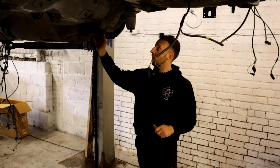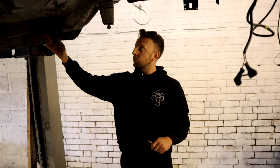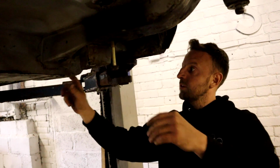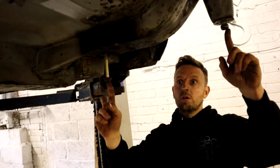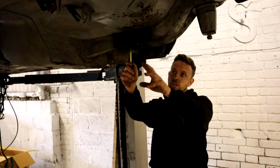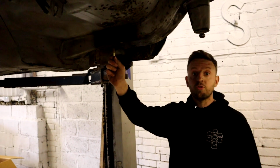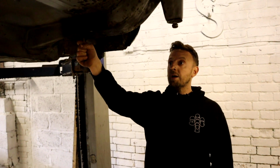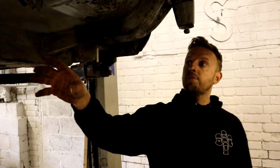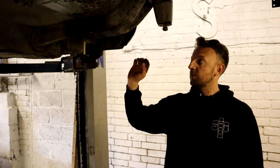As soon as you start cutting apart, you lose the reference point of that bolt, which is why I've kept it in this end. I can at least screw it in, and I can take measurements off certain points of the bodywork that are going to be the same on that side, which I've double checked, and we're in by whatever it is, a fraction of a mil, it's got to be absolutely bang on. So yeah, I'm going to get that side finished off, and we should have some parts back for the front end then, because they've gone off to sandblasting.